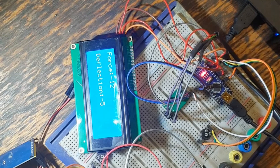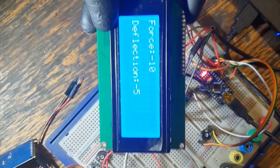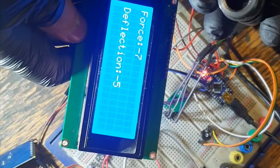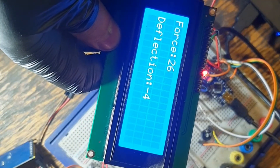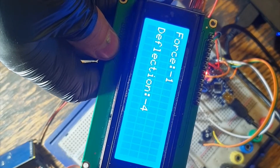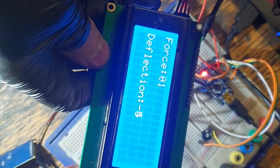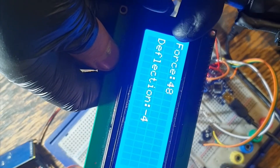After a little bit of breadboard work and some minor coding, I've got this. The camera's not picking up the display very well, but it's nice and clear in person. This is the load cell — it's got a hole through it for the threaded rod to go through the clutch. When I squeeze it, you can see the force increase and decrease when I let go. The actual force is going to be orders of magnitude greater than that, so I'm not bothered about it jumping around a little bit. It's probably going to be 100 kilos or something — I can't make that with my hand. I'm surprised it shows up at all from squeezing it; I must have made it quite well.